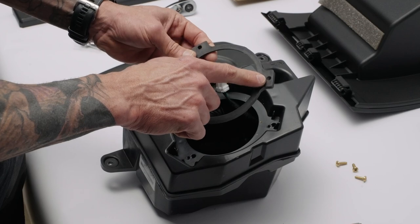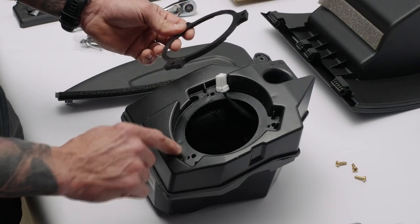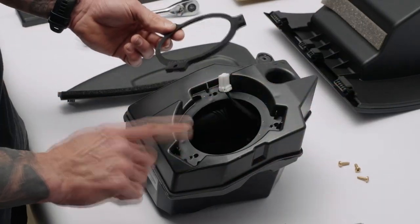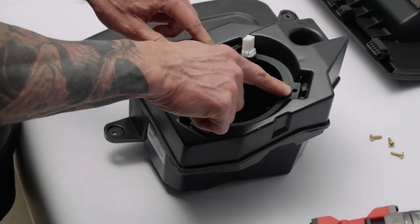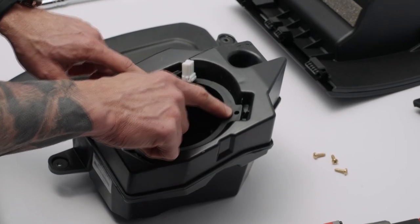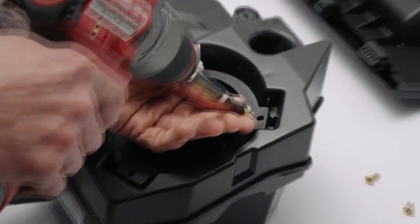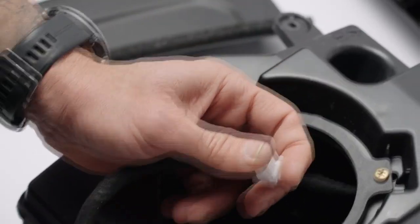Install the ring first with the Kicker symbol into the largest slot. There are two thinner smaller tabs, one wider tab, and with the speaker pod oriented as if sitting in the Jeep on the passenger side the wider tab goes to the bottom right. Line that up, then screw in the top two screws using the stock OEM screws, leaving the bottom one out for now — we'll use that to screw the speaker in. Then go ahead and attach the speaker connection.